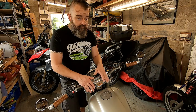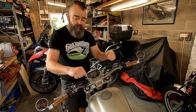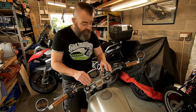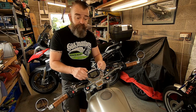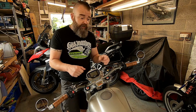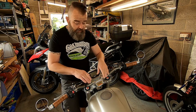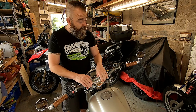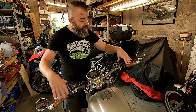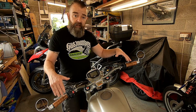Also, when I first rode the bike, I found that my right hand was getting a little bit sore — just at the angle. So what I did, I turned the bars back towards myself around about three degrees, and it seems to have eliminated that. The thing is, what a lot of people don't do when they buy a bike is they don't really set it up to themselves — they try and get round it, to how the bike's already set up. These handlebars are completely adjustable, and once you rotate everything forward you may need to do the bars, everything, and your levers forward to make it easy for yourself.